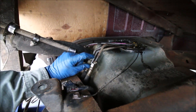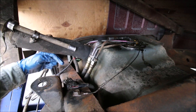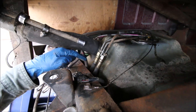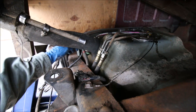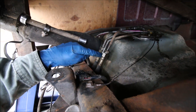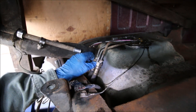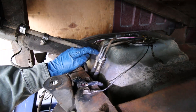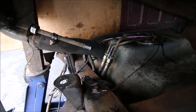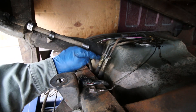I also cut the end of this hose because there was enough slack — this hose is only about 15 inches long. If this hose is bad it's got to be replaced; you're probably going to pull the tank to get to it because it connects to a hard line down here. However, there's slack, so if that's giving you a problem just cut it and you'll be able to pull the remaining hose up to that point. These two fittings are five-eighths — use a line wrench on your top fitting, hold the bottom with a three-quarter wrench, and turn the top.